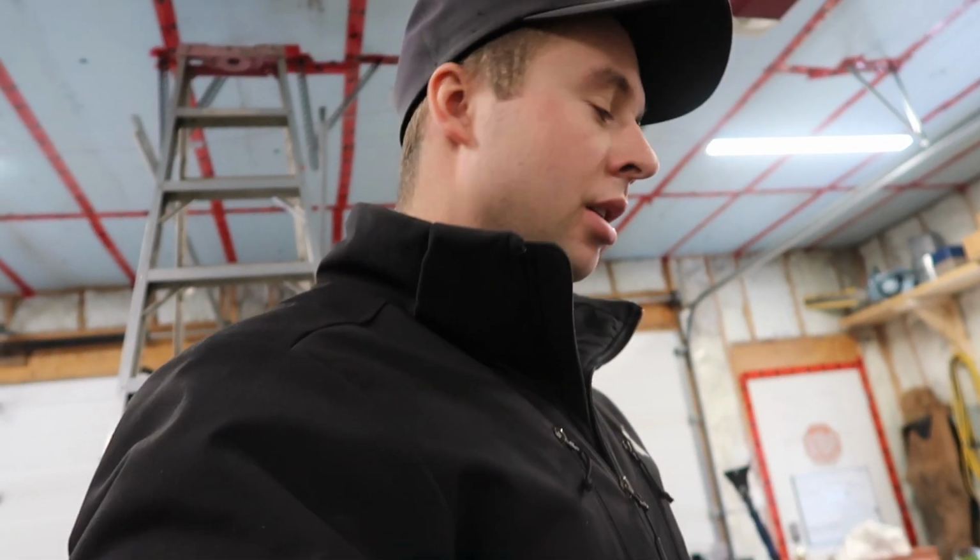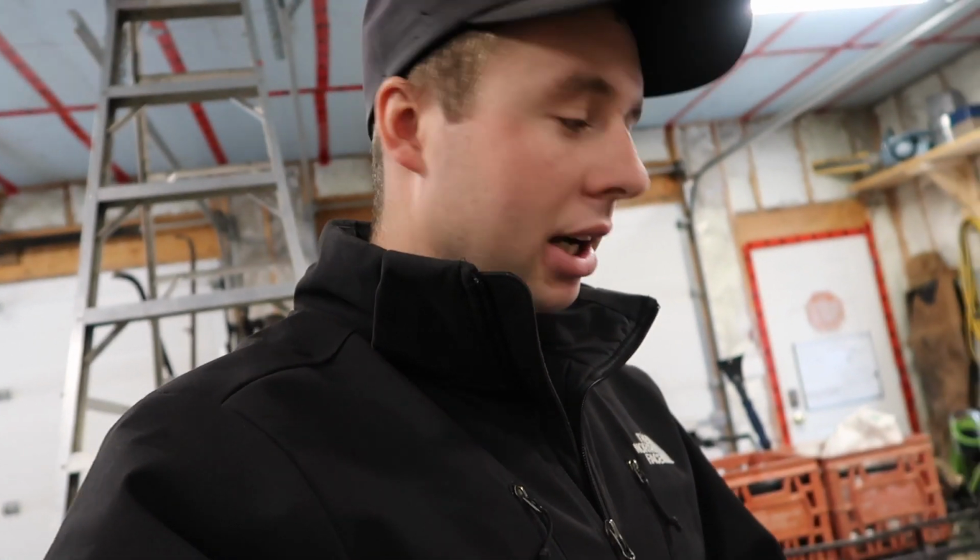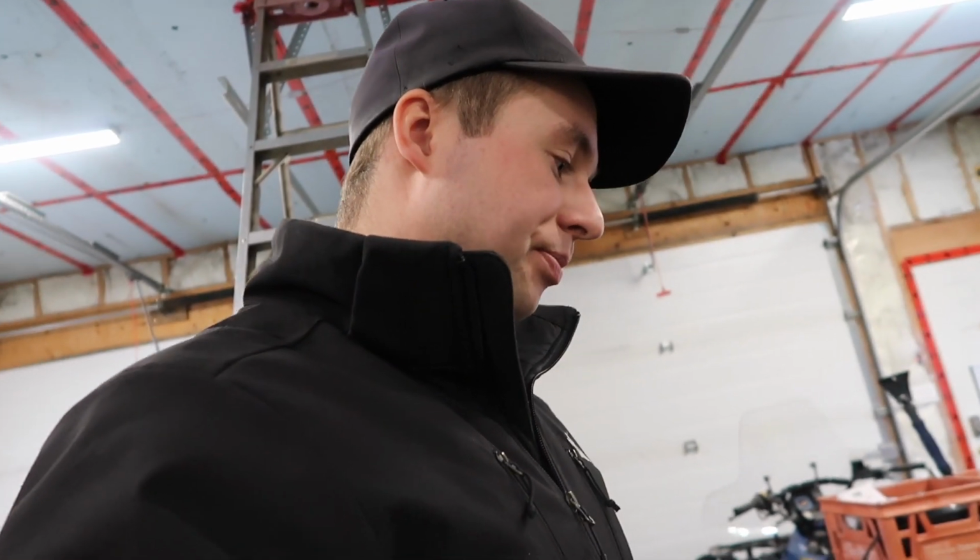So yeah, that's your main one. The oil cooler at the front, not a big deal. You can replace that in a couple hours, but it's still something to look for when you're going to buy one, and that's why I wanted to make this video. But if that oil tank's leaking out the back, that's a big job. I think Ski-Doo charges 8 or 9 hours to change one, because there is a lot of labor. So that's about it for the motor.